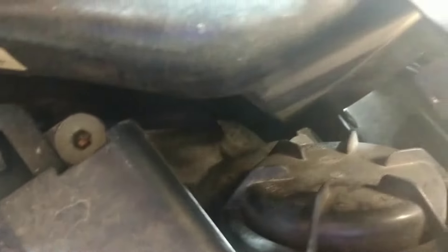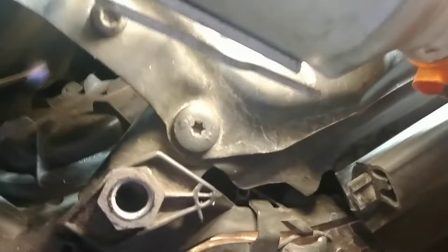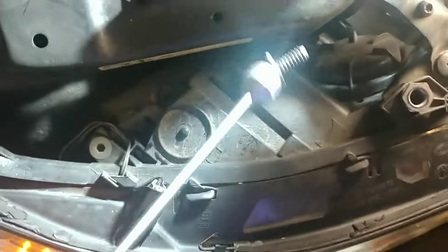And there are two more small bolts, much more difficult to see. One is down there through the slight space between the headlight and the body right there. So a couple extensions on an 8mm will take that right out. And because of the location it's difficult to get to, so do yourself a favor and pull it out with a magnet — save a lot of time.